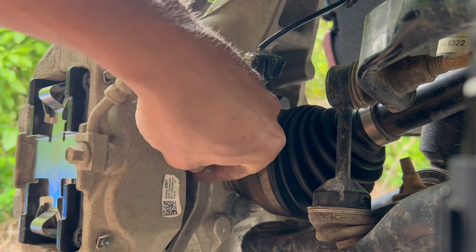In order to get the sensor in, you're going to have to fiddle around with it a little bit. The sensor is going to tell you when it wears down, so you want this side on the same side as the pads — flip it around, feel for that groove at the end of the pads, and then push it into place once you feel that. Once pushed into place, make sure that piece is against the rotor so it wears down with the pads. Just a reminder — this sensor is only on the driver's side, not the passenger side. So now you've got the rotor completely done and all you're going to do is replace your tire.